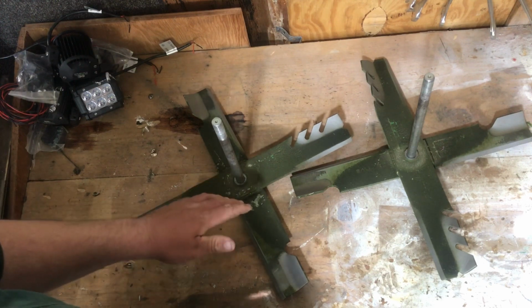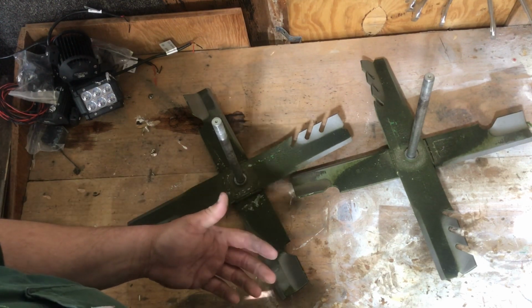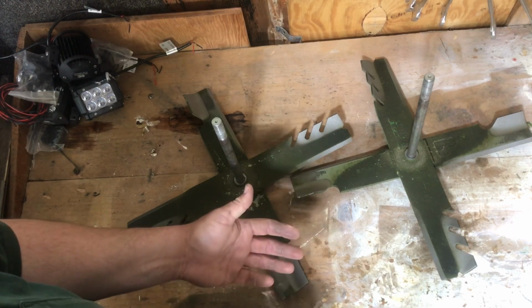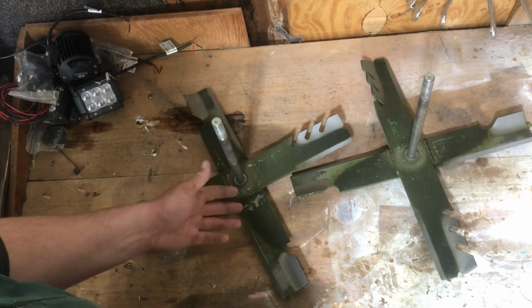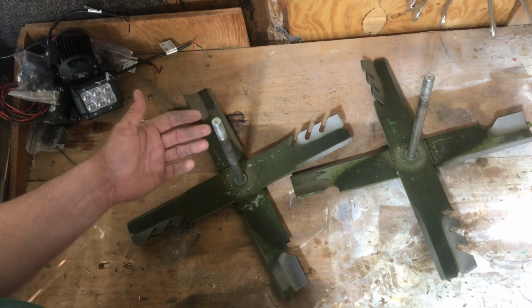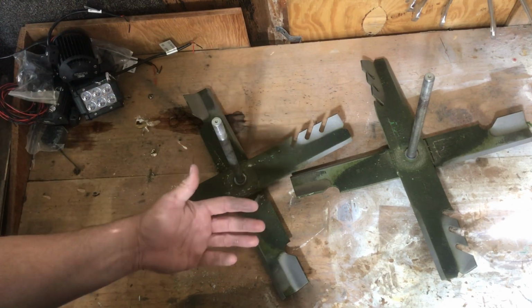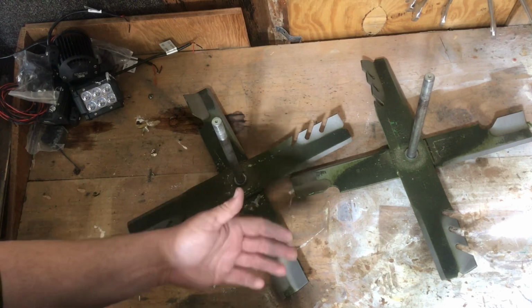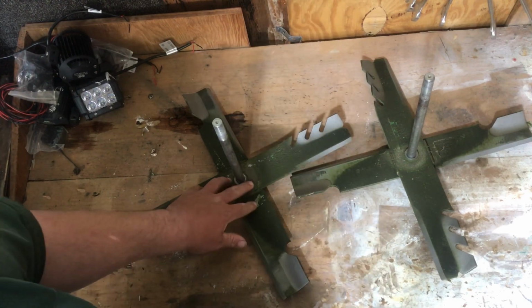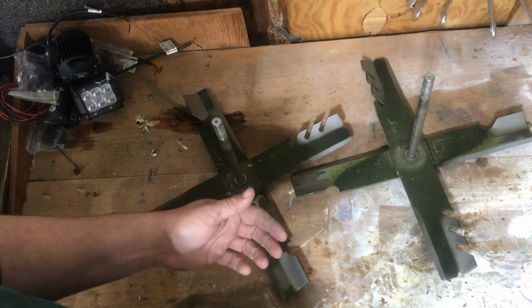So really, whether you want to run XBLADES or not, I think it depends on the type of lawns that you're running. If weekly accounts are all you accept, then you probably don't need XBLADES. It probably would be a waste. If you are like me and you have bi-weekly lawns, especially bi-weekly lawns where they fertilize, XBLADES really come in handy.